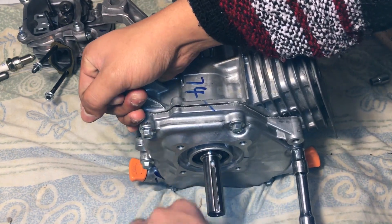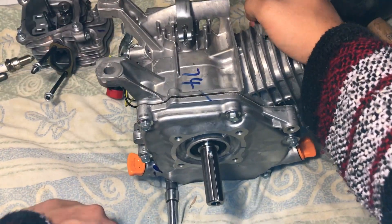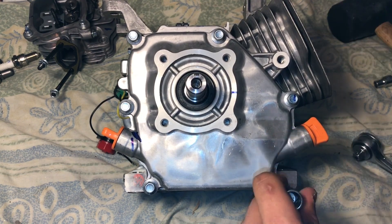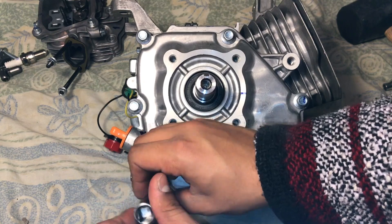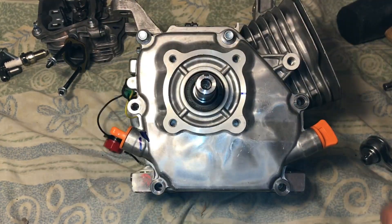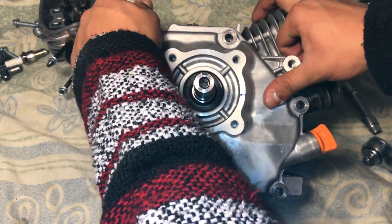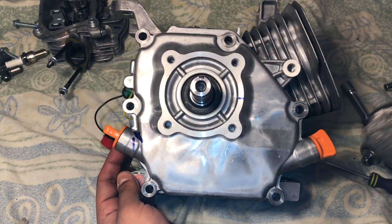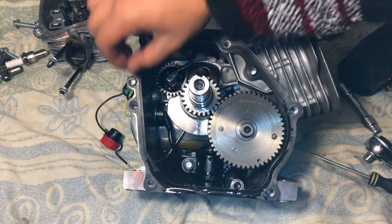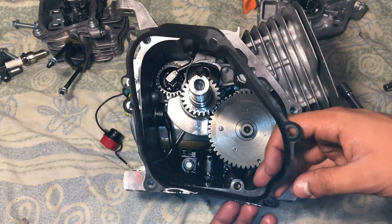For side cover removal, it's just 10mm. Break those six bolts right there — sometimes they're kind of tight because they are torqued down to spec, so this is one of the things you need to torque down. Break all of them and then pull them out with your hand. It's really simple stuff. After this comes out, it's really important that you try to keep that gasket safe unless you want to spend 10 bucks on a new one. I do this right away so my gasket's nice and new, and I slowly hit it with a mallet to take the side cover off. Just work with it slowly and try not to rip it.